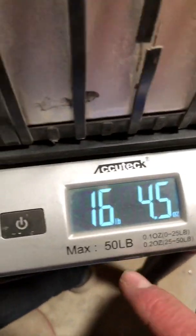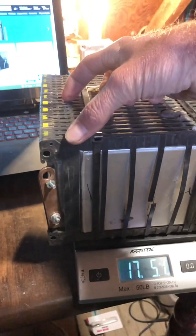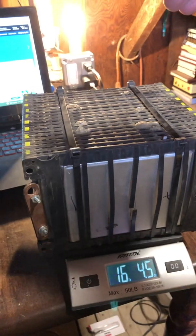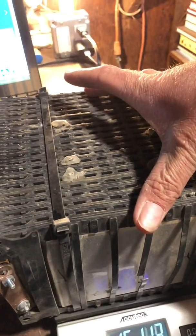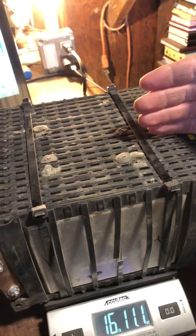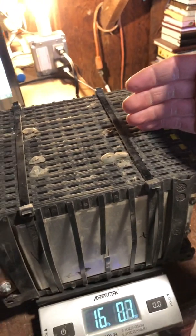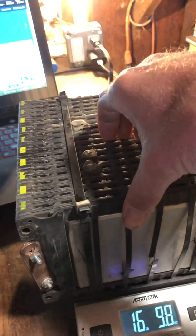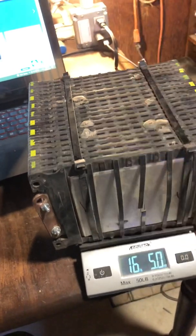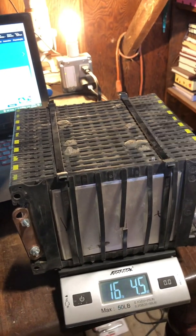Now it's slower, a little more boring, but super easy to put that battery in. I just wanted to show you how small and powerful one of these batteries can be. If we did the same thing with a 36 volt build and just did 10 batteries in series instead of 20, we'd have a 36 volt battery that would get up to around 15 miles per hour max. This battery would be able to do it — I could build a battery that size and drive around, probably one to two miles with it.